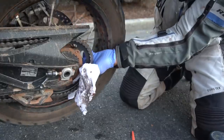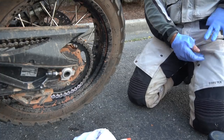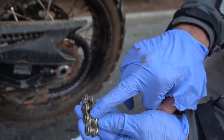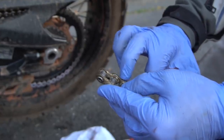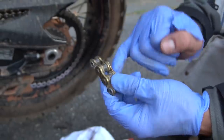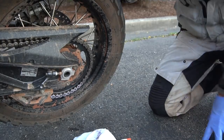What that means is that the chains are internally lubricated — I'll show you an example. If you look at the chain right here, between the outer plate and inner links there's an o-ring in there. That's what we're really doing when we clean the chain — we're trying to clean it so that area doesn't get a bunch of gunk and grime in it, because the pin that runs through the chain is lubricated internally. So as long as we protect that o-ring and keep it lubricated and keep the fluid on the inside, our chains can be in good shape. Rust on the outside is cosmetic and eventually can be a problem, but mostly the most important part is just keeping this thing clean.